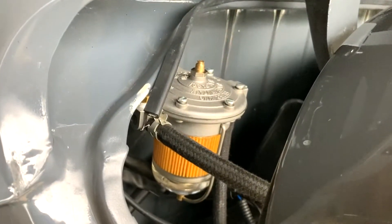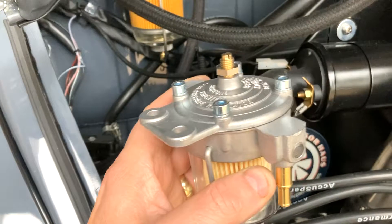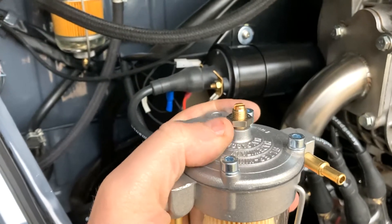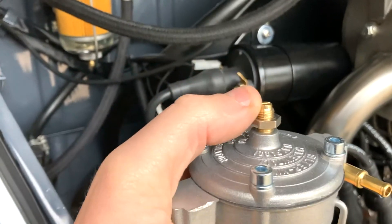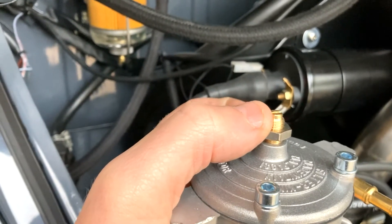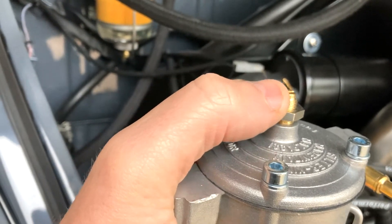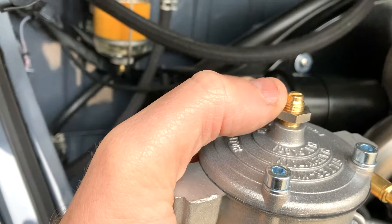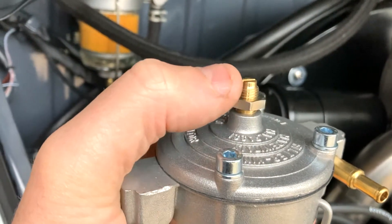Here we are in the bug - I've got a fuel pressure regulator here to help explain what you need to do. To adjust the fuel pressure regulator up or down, remove the locking nuts and keep those loose. Then use the little brass adjuster: turn it inwards if you want to increase the pressure. If you want to decrease the pressure, which is what we want to do, adjust it outwards. You'll probably need to do this a few times to check that you've got no fuel leaking from your overflow.